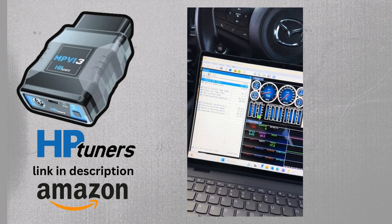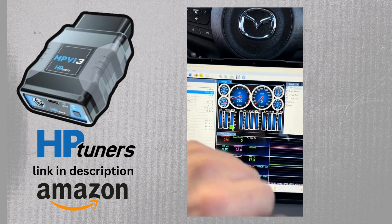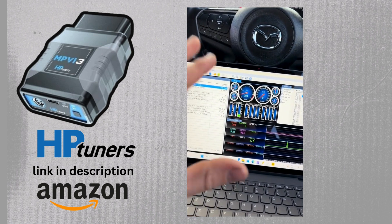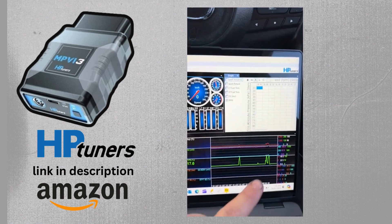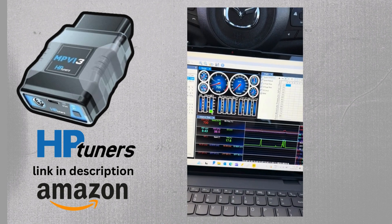Once you get into the car you can see there are quite a few options here. You've got MAF, MAP, RPM, vehicle speed, cooling temp, intake air temps and a few other things on the bottom. With this you can literally live data stream most of the things if you're trying to find an issue — you can pick them out, put them all here, watch what all the values are and make sure everything's within its parameters.